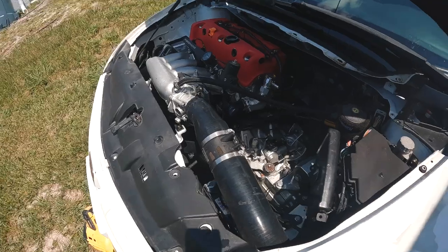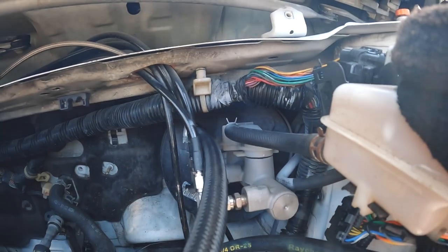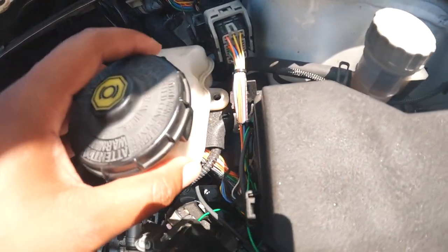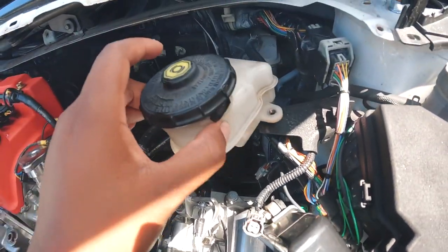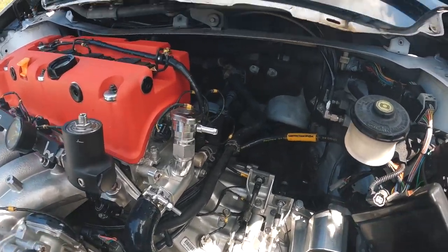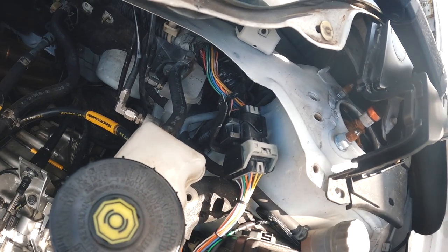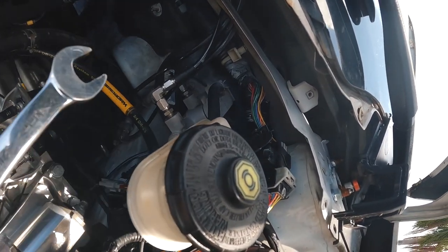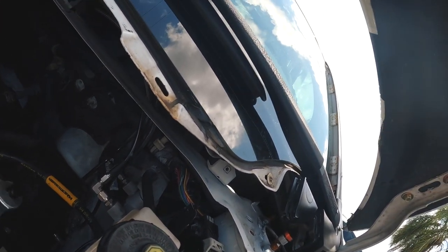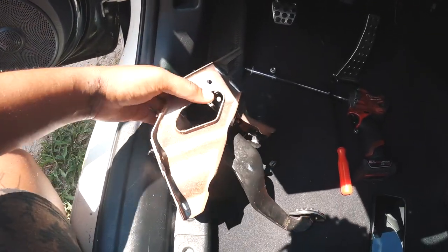One of the things we have to make sure is that when we put our brake booster delete in, it clears everything. So I went ahead and removed the 10mm bolt and unclipped it from the bracket to have the reservoir loose, then drained the brake fluid. Once we have the two lines done, we just go inside the car, remove the four nuts that secure the brake booster to the firewall, and pull out the master cylinder and brake booster together.